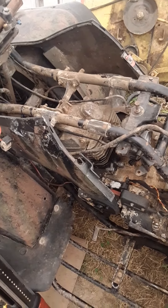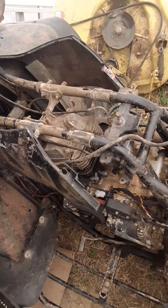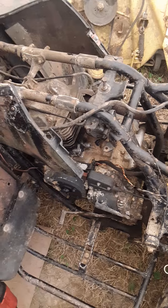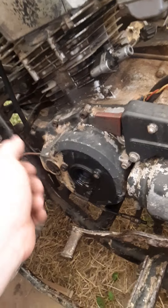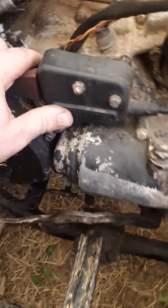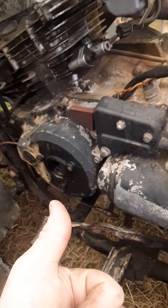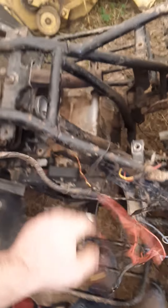Top ends aren't that bad. There's a Kawasaki Bayou 300 two-wheel drive engine on Facebook — somebody just chopped it out of the frame, it's got bits and pieces of the wiring harness on it and a carburetor, so 50 bucks — yeah, I'll go buy that. The pull start on this one is busted off, the screws are broke, but not really worried about it — at least get the electric start to work. The case has got a crack and somebody tried to fill it with RTV. First thing I want to do is make sure the engine's good — compression, timing — then remove all this wiring, take it inside to the workbench, get a wiring diagram, and I think I'm just going to build a new wiring harness.